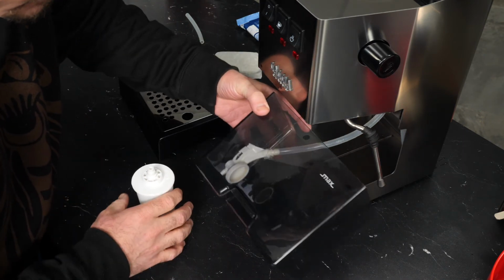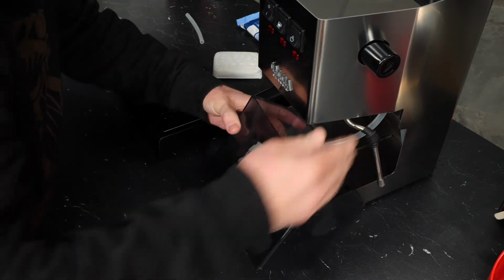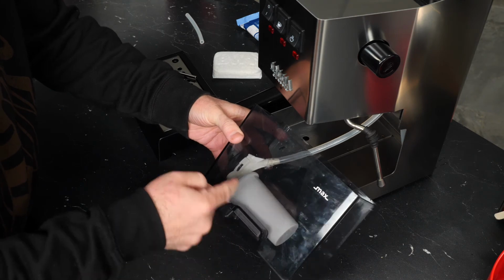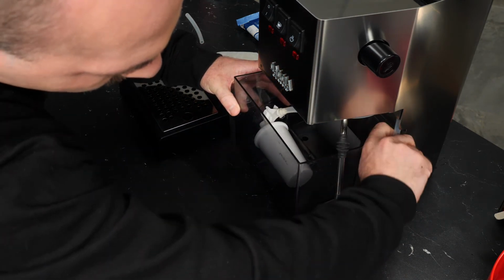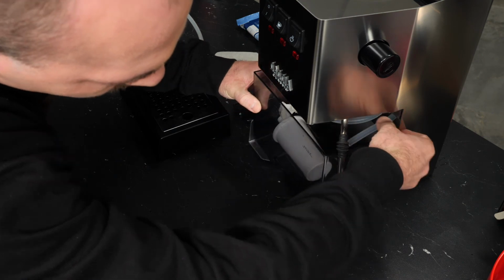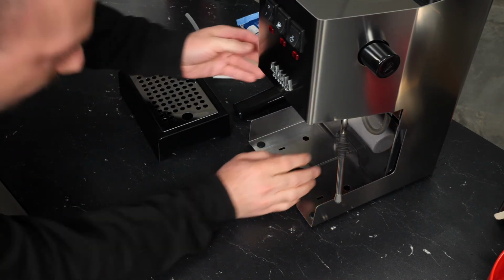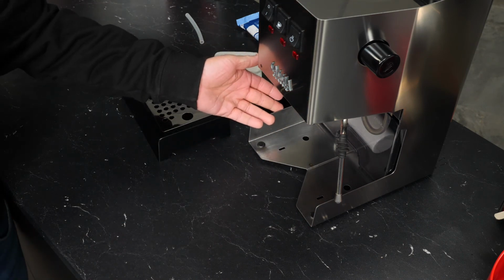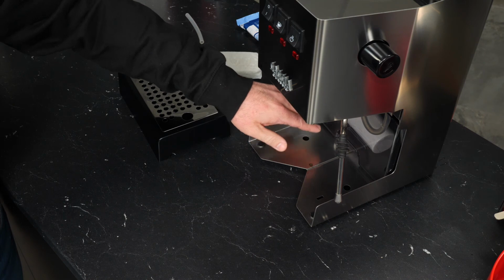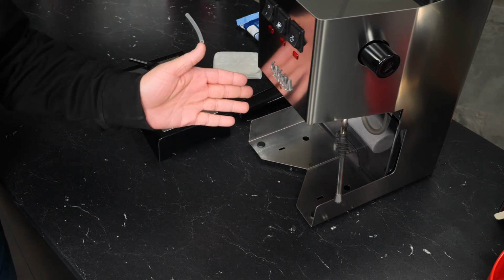So we've got that, and we'll go ahead now and insert the cartridge. So you can see, and now simply we'll go right on ahead. We'll take our water return line and then simply slide things back. Now we have this set up, and we can actually fill the tank with water, and we've got it set so that we can have that water drawn through the filter before it reaches the boiler.